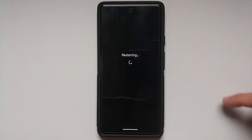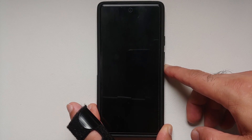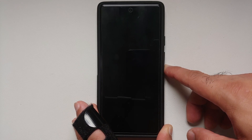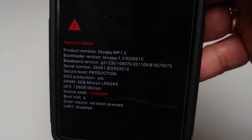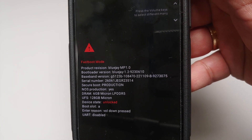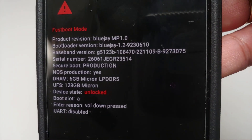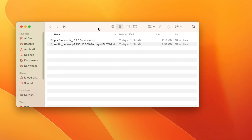Once you've removed all the accounts and security measures and rebooted your device, we need to boot into Fastboot mode. To do that, restart your device — as soon as the screen goes black, press and hold the Volume Down button, and that should ensure you boot into Fastboot mode. And there it is — you can see this is how Fastboot mode looks. Connect your phone to your computer while your Google Pixel is in Fastboot mode. Now it is time to flash the Android 14 Developer Preview on my Google Pixel 5.